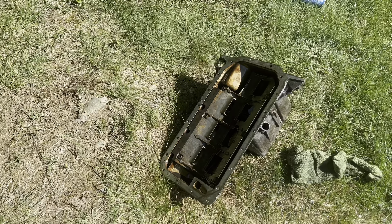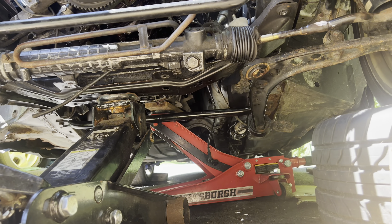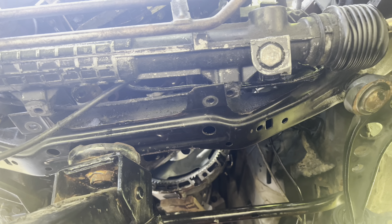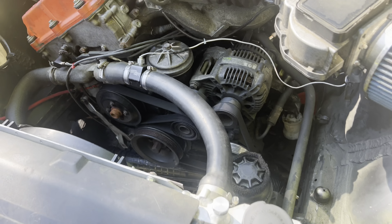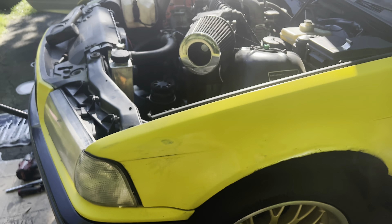Many hours later and I have the pan out. I thought it was gonna be easy but turns out you gotta drop the subframe — yeah, it's just a whole thing. Now I am currently taking the gasket off, gonna put the new one on and button everything back up. The old gasket was stuck to the engine side and it was a nightmare — I had to use a razor blade and sit there for like an hour carving all the gasket off. Now I'm gonna get the new gasket tacked on there, get it on the engine, and tighten it up.